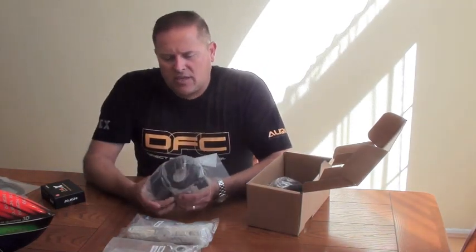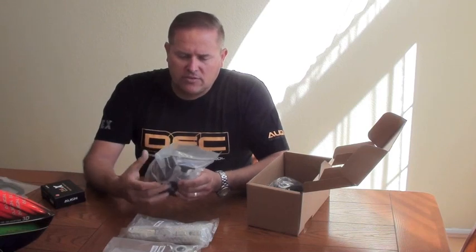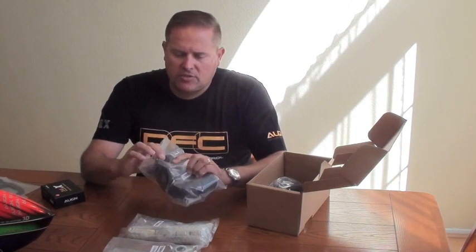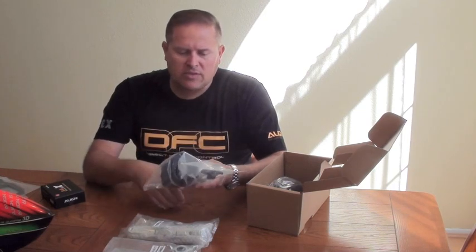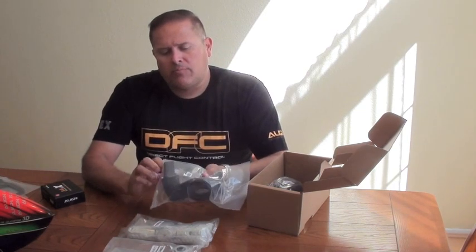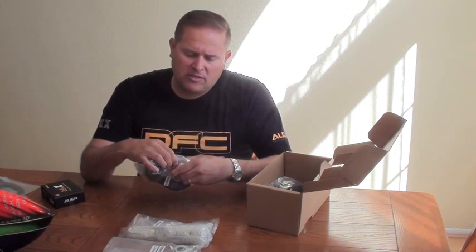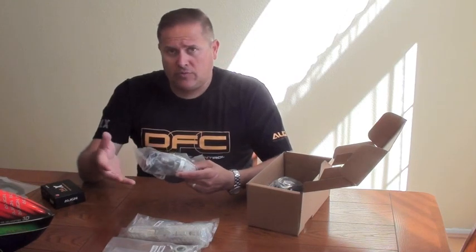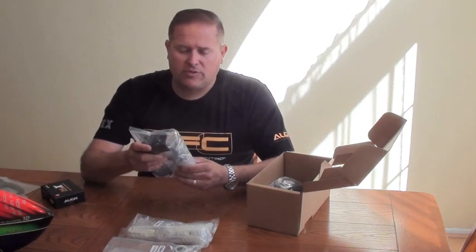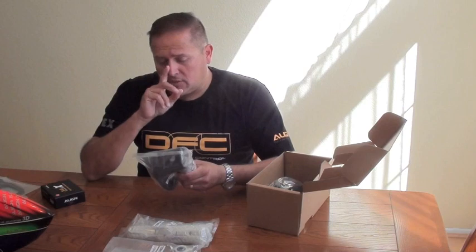Also of note is the fan shroud. This goes around your actual fan unit to cool your engine. You'll notice that there is a bearing block that holds the clutch, the pinion assembly. Of note on the pinion itself, it is a helical cut gear, and that's for use with the auto rotation gear as I showed you previously. It is helical both on the main drive side as well as on the tail on the auto rotation side.